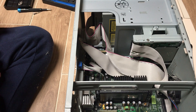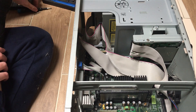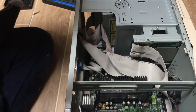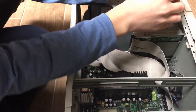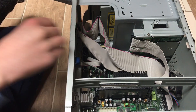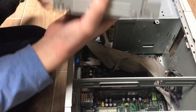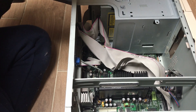If you're just trying to get to the hard drive, or wanting to replace a floppy or CD-ROM — well, the floppy is actually easy. To remove the floppy drive, just unscrew this one Torx screw right here, and then it should slide right out. Then pull and unplug the connector, and the floppy drive module is out. It has room for a second bay, even though there's no way to actually fit a second drive in there and have it fit, which is a bit strange.